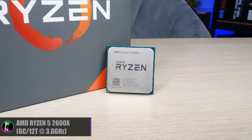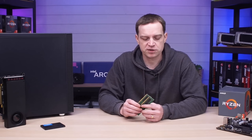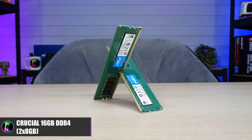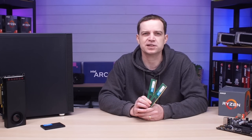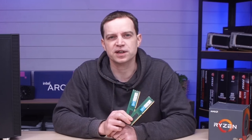It is a slightly older generation CPU, but it is a 6-core 12-thread processor that is more than capable of gaming still today. For RAM we've gone as cheap as possible — it probably isn't the most ideal, but I managed to pick this up for around £15. This is 16 gigabytes of DDR4 running at 2133MHz, which is not great for a Ryzen processor, but it's going to get the job done. It is basic green sticks with no heatsinks, but it's going to work.